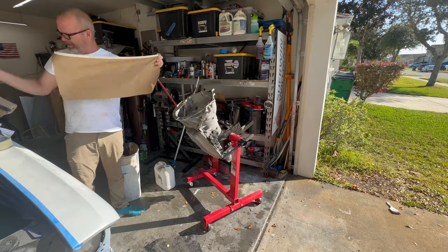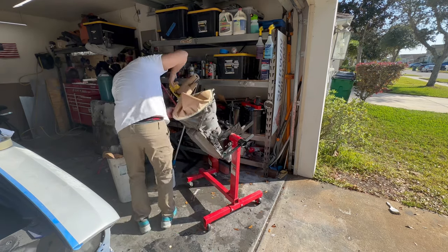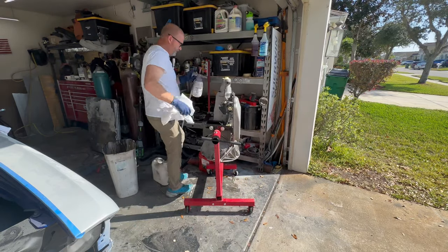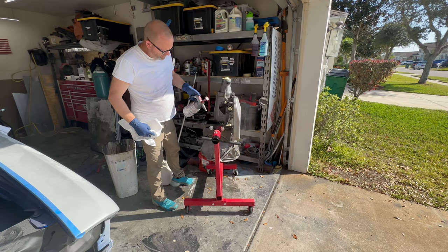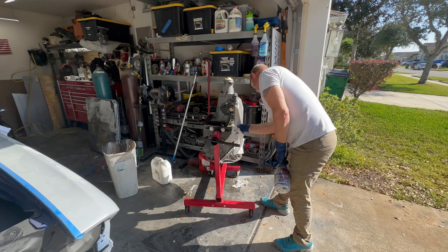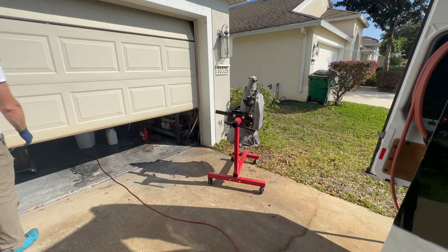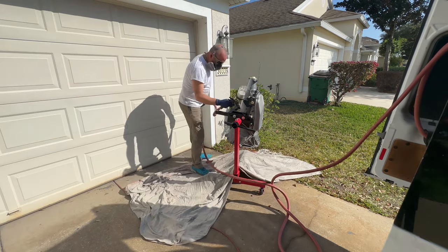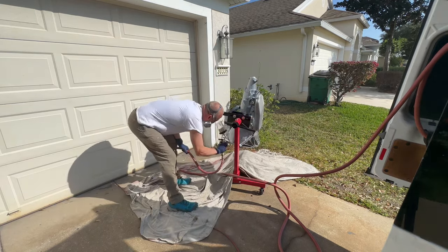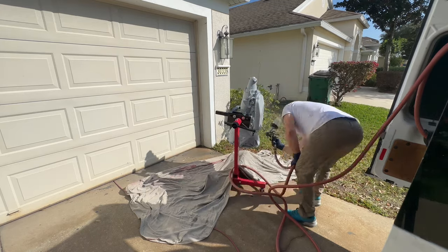I put some stir sticks in the gaps to create that gap, then masked it all off — pretty straightforward. This is prep cleaner, also known as wax and grease remover. You want to clean every single inch of what you're doing, because if you don't you'll see solvent pop — or fish eye, which is like an exaggerated version of solvent pop. As long as you clean it and scuff it, you're good to go. I use a turbine spray system, which is a lot more efficient than a regular system. I used just a couple ounces of base coat — well, this is actually the epoxy first, and then the base coat.